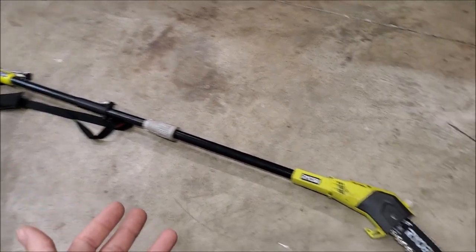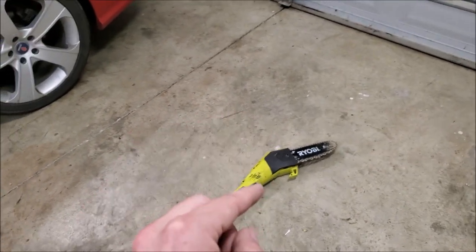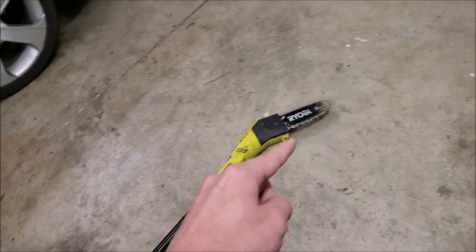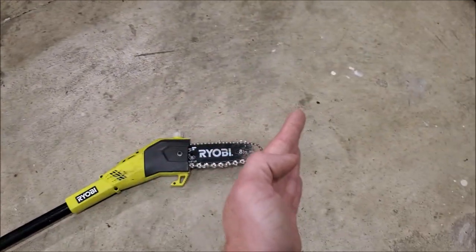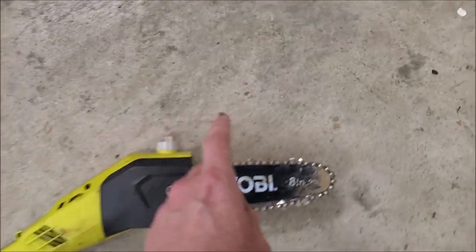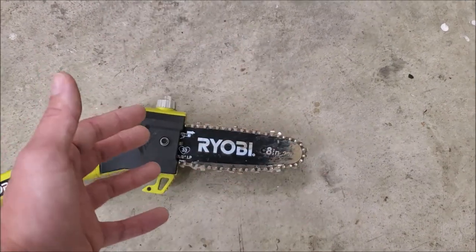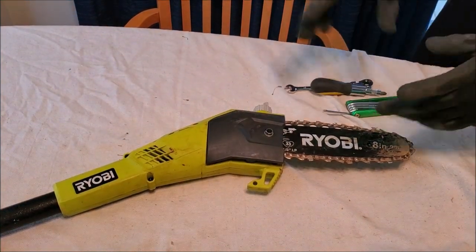My wife just bought me another one - she didn't think I'd fiddle with this one. So I did a little diagnosing first: I tried a couple different batteries and it still did not work. I then took the new bottom portion and plugged it in - basically the new bottom is new and the pre-existing old top is the old one. It didn't make a difference, so that isolated the issue to the top piece. Now what I'm going to do in this video is tear this top piece apart and see what I can find out. More than likely the motor is just done - it probably got dry, got hung up cutting this tiny log, put too much effort on the motor and just cooked it.